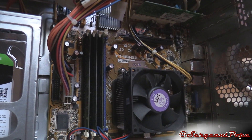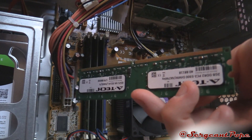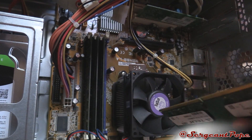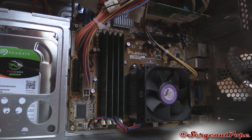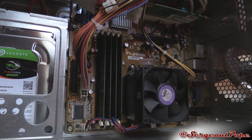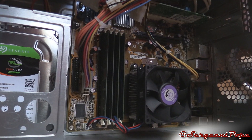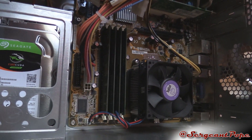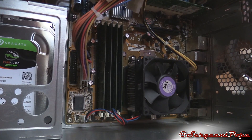You can swap out the RAM sticks because RAM can cause really weird issues like this. As you might be able to tell, the RAM wasn't the issue on my computer. I actually bought new RAM since I was going to upgrade it anyway, and I tried the new RAM - it didn't work. The computer still shut off. With the old RAM it did that as well, regardless of configuration. So that didn't fix the issue.